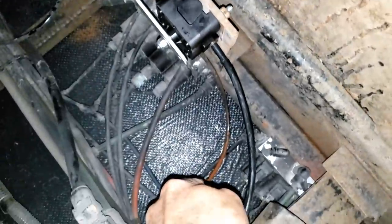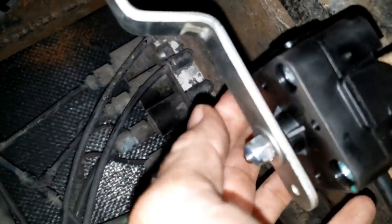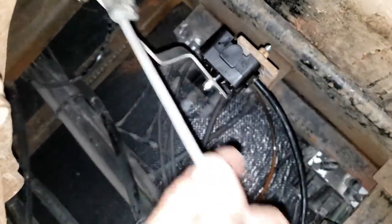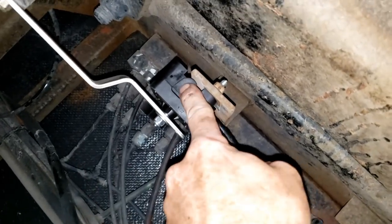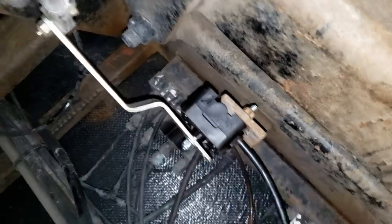I still didn't have any airbag control. When I disconnected that brown line and lifted up on it, it would pump air out, but it would also put air out of this exhaust port — that's why somebody kinked that off. The alarming part was that if you try to release air, it wasn't releasing air — what's releasing is coming out of the air tank. So it's exhausting and putting air into the system, but it's not doing the opposite. I don't know if this is just plumbed wrong. I'm going to try to re-plumb this real fast, and otherwise I think we need a new ride height control valve — which is strange because this is brand new. That's probably why somebody kinked that side off, to keep the air from leaking out of the system.